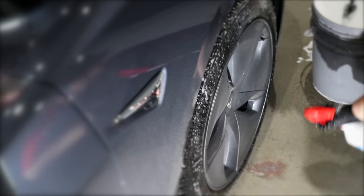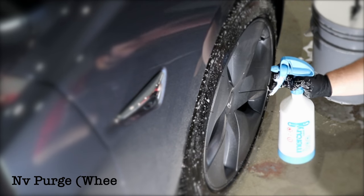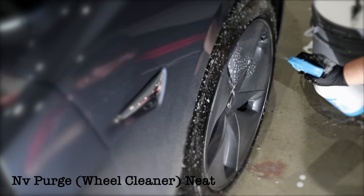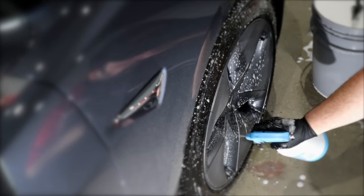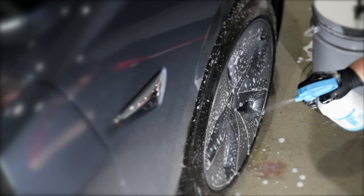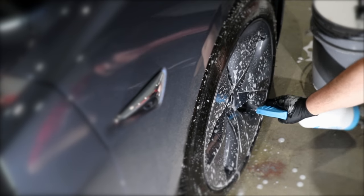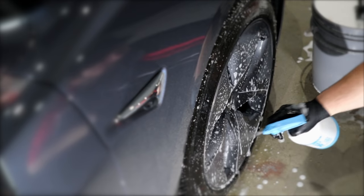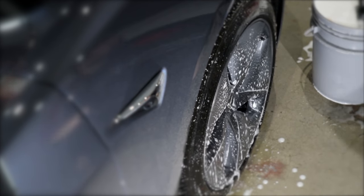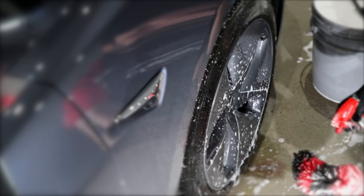As with every car I ceramic coat, it will start with a full exterior surface cleanse and decontamination, and as it's a new car that shouldn't have more than very minor defects, it'll undergo a paint enhancement correction process to further extract and enhance the gloss and clarity of the paint, as well as prepare it for the Nova Pro coating that the owner has selected. Apart from that, the owner has also opted for a windscreen coating to protect the quite extensive amount of glass on the vehicle, but decided not to go for a wheel coating.